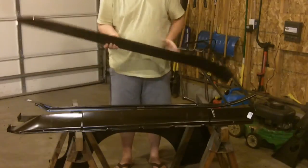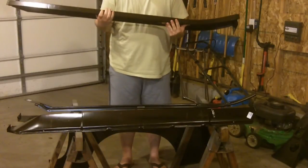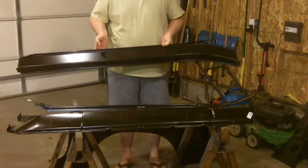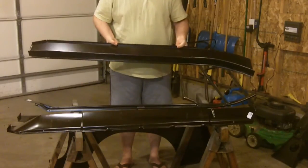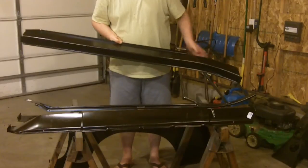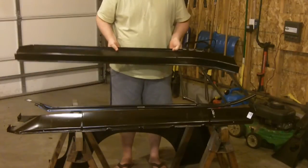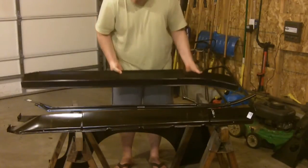This is what you see inside the car. One thing to note: you're going to want to check out and see how rusted through yours are. I bought these pieces separately for one side. The other side I bought the kit from Moss Motors, and it looks like the kit is only a partial — it stops right about here. So if you're rusted out back here, you're going to want to check that out and confirm before getting that kit. I'm going to be okay on the passenger side inner sill, so it shouldn't affect me.